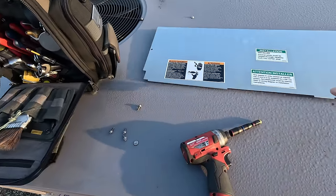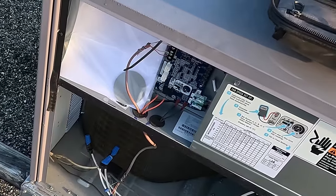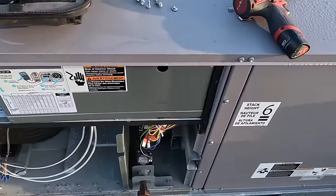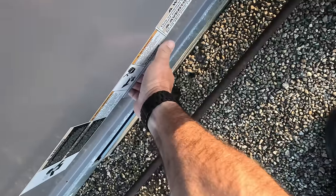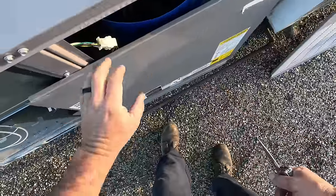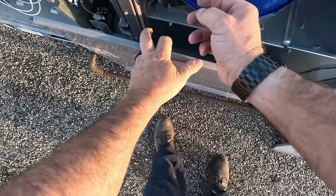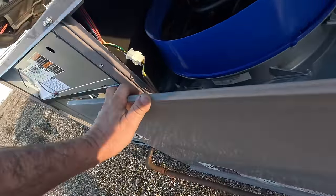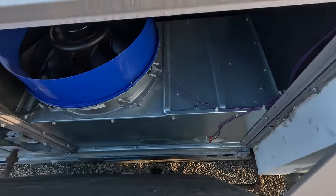It says he can run the blower, which I guess is a good thing. It's got that expensive, hard-to-get blue capacitor deal — which means this right here. Yep, it's the blue thing. We'll just check it to see if it's alright. It feels like it really spins — nothing looks to be rubbing on anything.